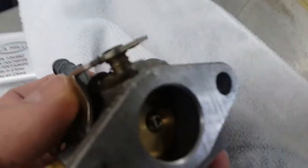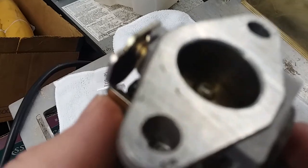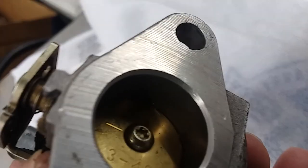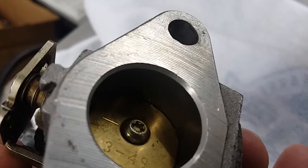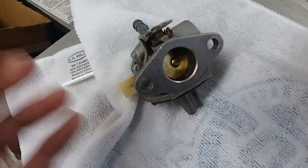As this throttle slows down, there are just different ports in there right at the edge of that throttle plate. I may need to get some more light in there, but you can kind of see a little tiny hole. So that would be active when it's idling — when this throttle plate is closed it would still get fuel.